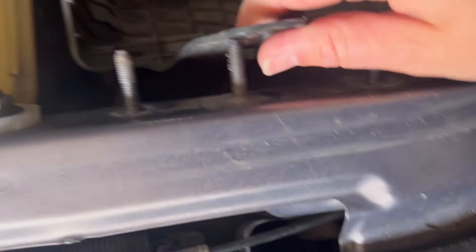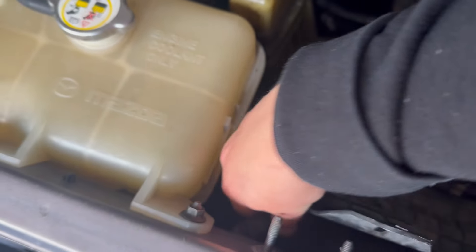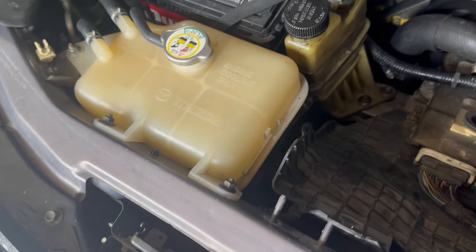Okay, so took it for a drive, just got back. Pulled the intake up so you can try and look at the fan — it's definitely not running. I don't think I unplugged the fan when I did the swap, but maybe I didn't — it's not plugged in. So I'm going to try and look at it real quick. You can see it from this side. It's definitely not on. There's clearly the wire that goes to it, so I'm going to turn on my flashlight and see if that's connected. Okay, so did a little research and looked at this car. The fan's definitely plugged in, and it looks like this year — specifically the '06 — does sometimes have a problem with the fan motor not working. So it looks like we might be needing a new fan.